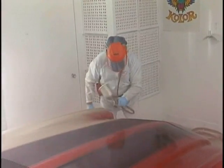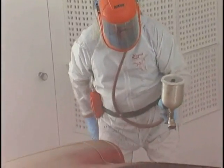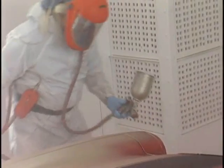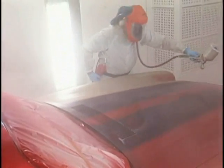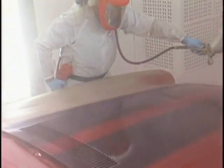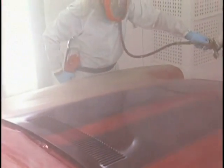Remember, the same problem can happen on the center of the hood by overreaching and making a stripe in the center of the hood. So when you get out there, pick it up at the right point so that we're maintaining the continuity that we want. It takes extra effort to parallel that air cap. Make sure that you do that always, using invisible straight lines, robot attitude.